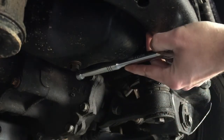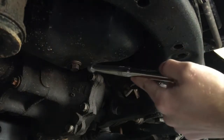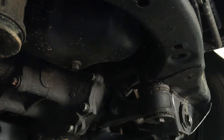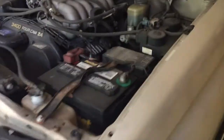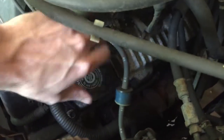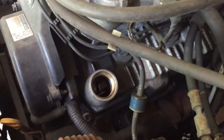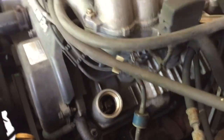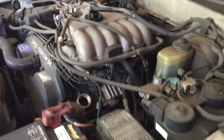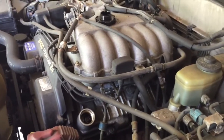This little bolt right here is what we've been going for — this is the oil pan itself, and this is the drain where the oil is going to drip out. First, locate the crankcase cap on the engine and take it off; when you remove the drain plug the oil will flow out much more freely. It's also not a bad idea to take the car for a little drive beforehand so the oil warms up and flows out more easily.